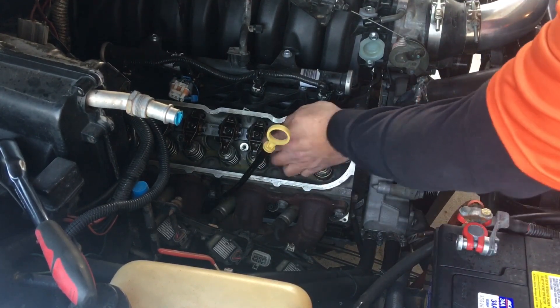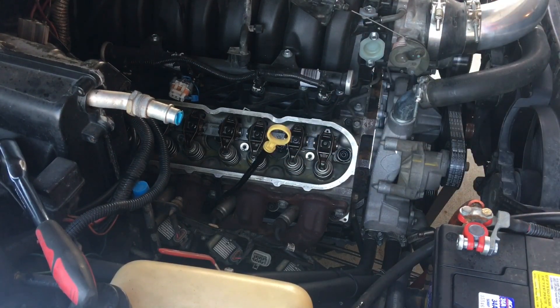That represents zero lash. So basically at 7.325, the push rod length checking tool is saying there's zero clearance between the lifter plunger push rod cup and the push rod cup on the rocker arm. So now you would add to that 7.325 whatever lifter preload you're after. Comp Cams wants you to run 50 to 60 thousandths; several other cam manufacturers recommend 50 to 70 thousandths; Brian Tooley recommends 90 to 100 thousandths preload. Do your research and find out what works for you — generally you want at least 50 thousandths or more so you don't get a super loud valve train.